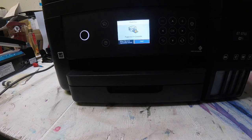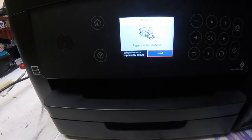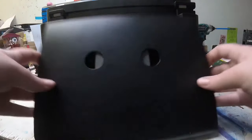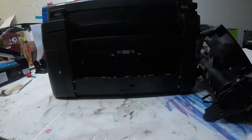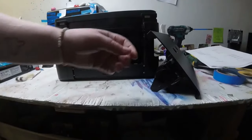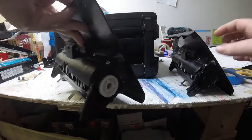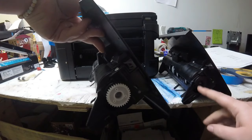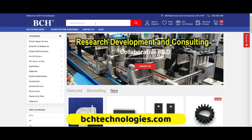So usually the next thing that I look at is something with the duplexer on the back there. So pulling out that back duplexer, and we'll take a look at that. So that's the one from the printer, that's with the error. And I went and grabbed another duplexer so we could compare it and see. Kevin and I looked at this the other day, and Kevin is going to see if he can make some parts. So the thing that we have that's not the same here is we have this one gear that is missing.